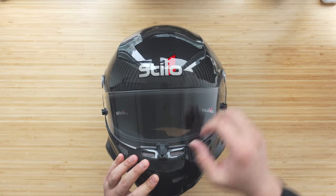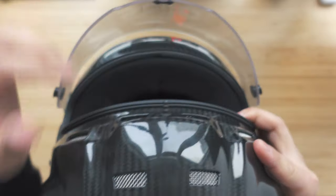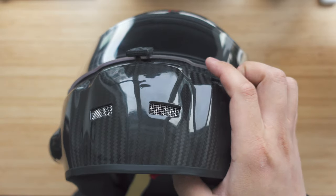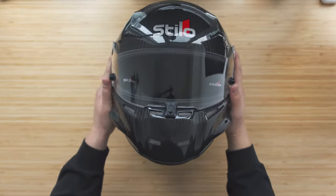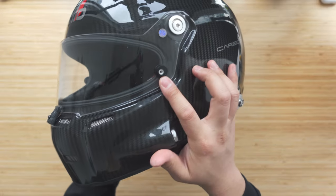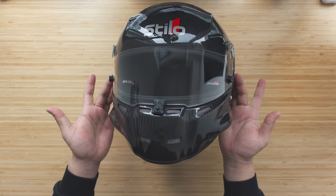What's really cool about the lens — the visor — is that it's actually a two-position visor. You can see there are two stops on it. When you bring down the visor, it can click onto the first stop, which allows you to have a tiny gap underneath the visor to let airflow in. If it's necessary to have it fully closed, push it again and it goes one more stop to have a firmly closed, airtight seal at the visor. The visor also comes integrated with tabs for ripaways, for open wheel or karting — or potentially endurance racing in a car with no roof in the rain.